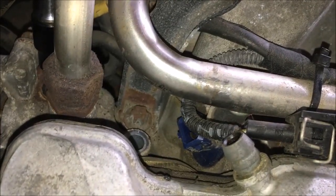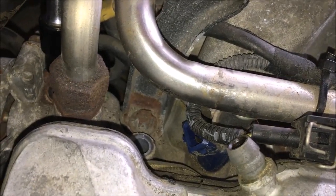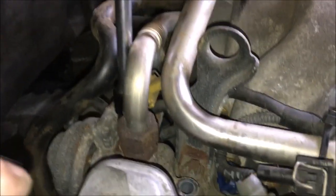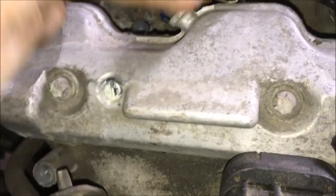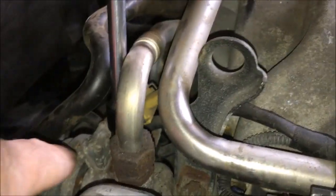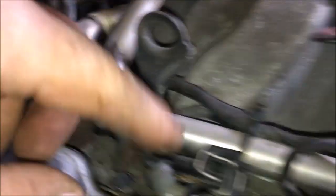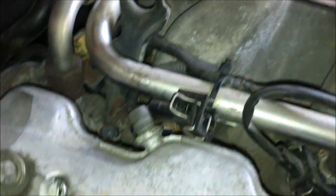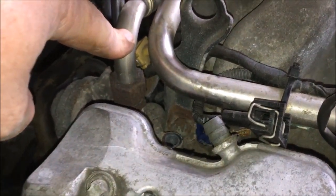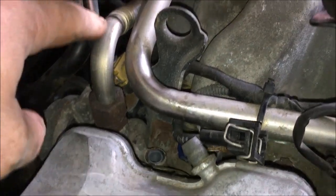I have to wind that back down a little bit and take that bolt out. There's an electrical connector — it's the same style as the others. There's a yellow electrical connector back there with two little spring clips; pinch them in and pull it out. That's the electrical connector on the EGR valve — unclip that and pull it off.